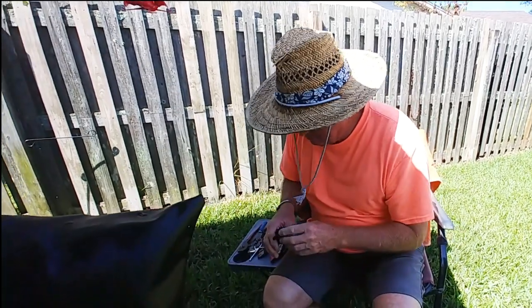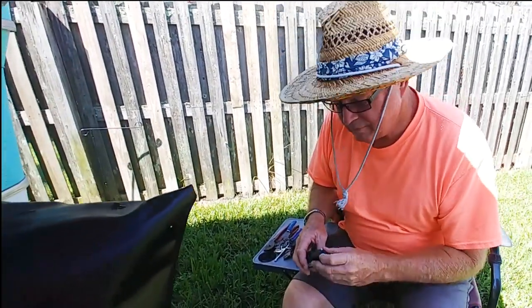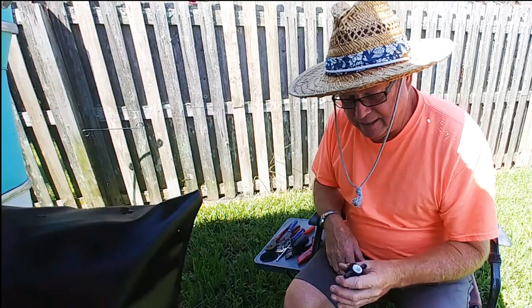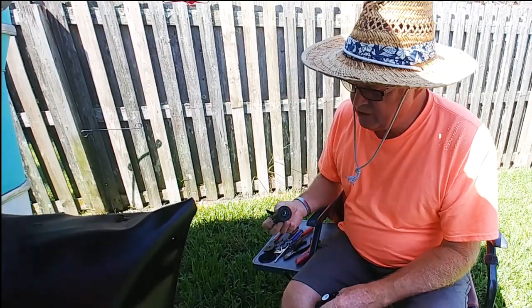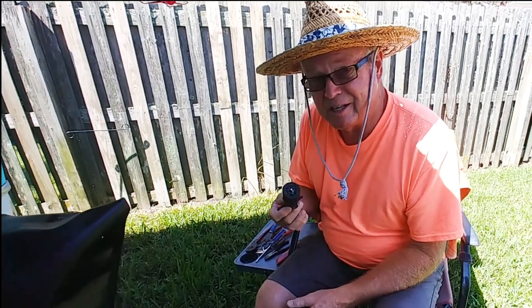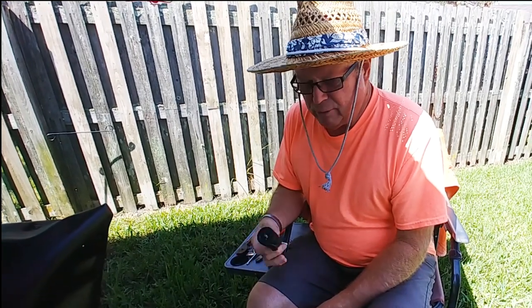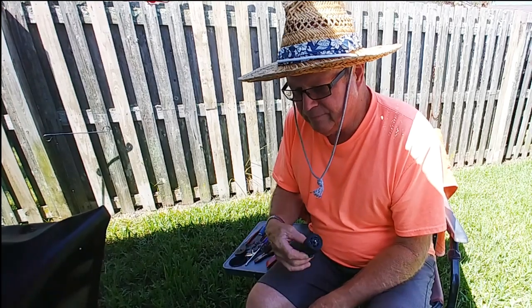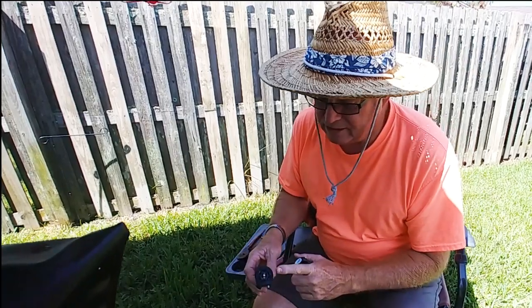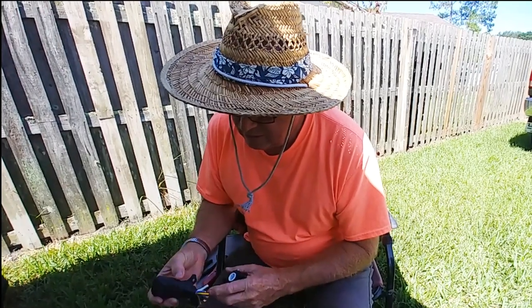Good morning everybody. Just doing a little electrical repair here on the trailer side of the house. This is the original plug that came on the Rambler — it's a 1970, so this thing is almost 50 years old. It was getting where I was losing connection going down the road. My brake light would come on saying no connection, indicating the trailer wasn't hooked up, and my running lights would go out. I diagnosed the problem down to this old plug. It just wore out, so I cut it off.